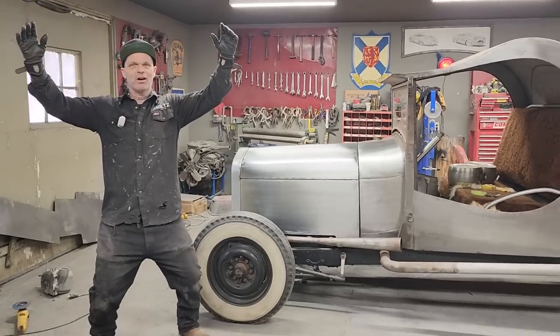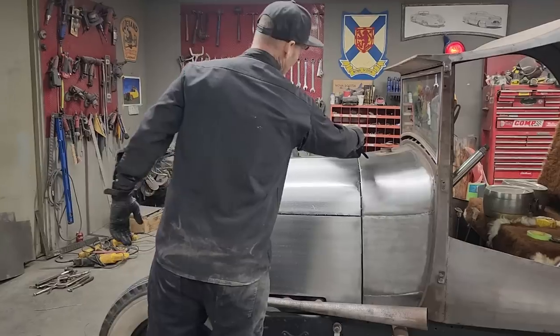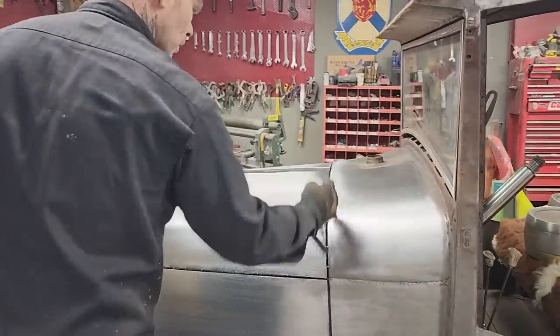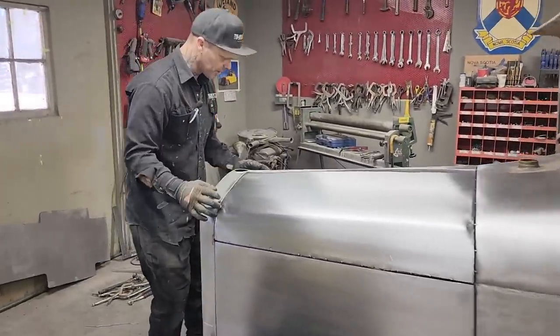How am I going to get the hood off? Well, I'm going to show you. The hood is tacked here with round rod. For the people that didn't get to see when I first done it, I've tacked the hood to the cowl with round rod all the way along there. We've tacked a piece of square stock from there to there. We've tacked the square stock here in a couple places, not just a couple places up here on the grill